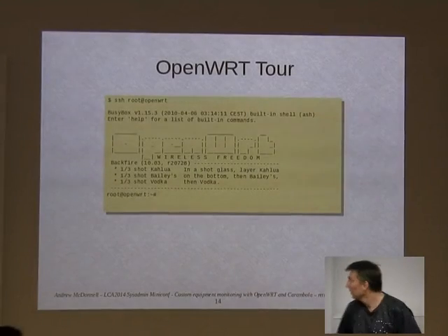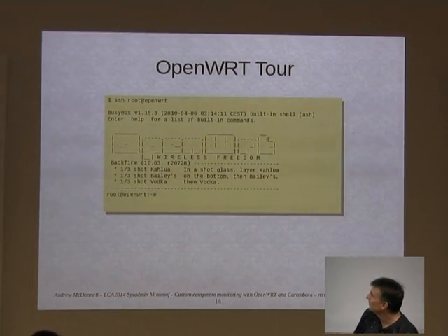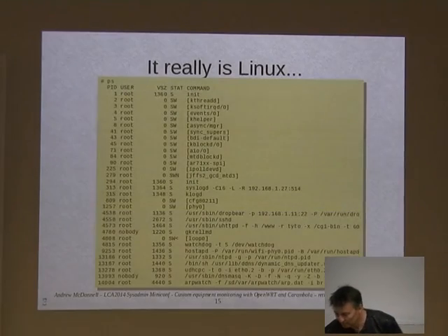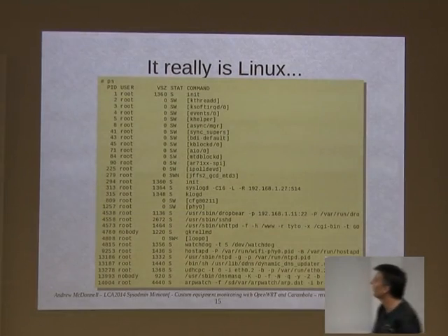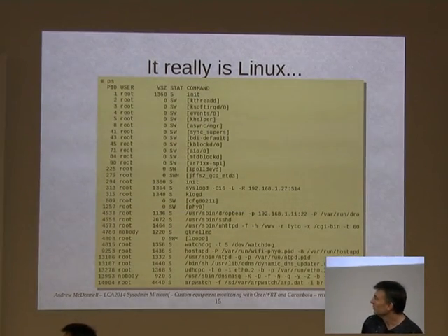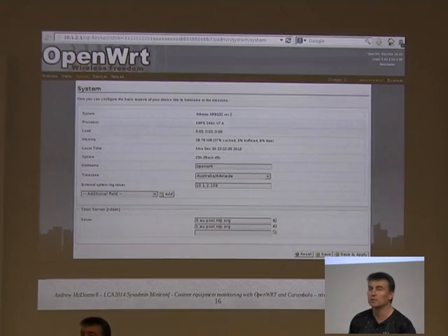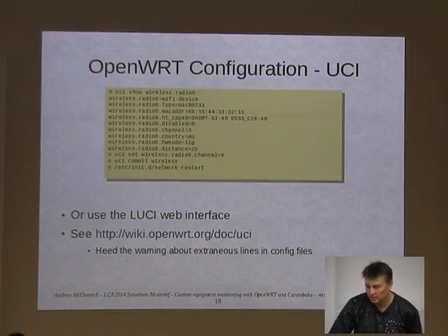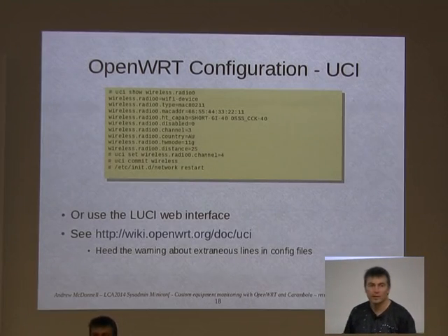There's a web interface for it. I don't really have time for a full demo today, so I'll just give you a quick tour. It's definitely Unix — if you log in, they seem to name all the distribution versions after various drinks, which is quite interesting. You can log in and see all the processes running. This one's not doing a lot — it's just running the Wi-Fi connector and NTP. That's the web interface, it's called LuCI, running via CGI, and all the packages are designed to work with UCI, which makes it easy to configure without needing to build a custom web interface.